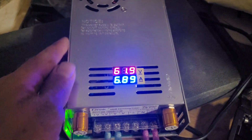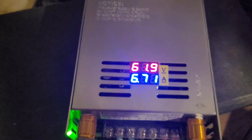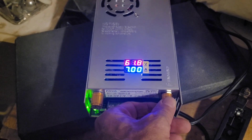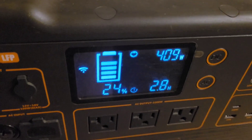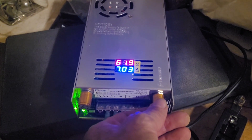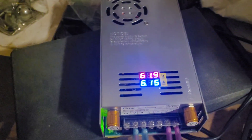I would say the Tacoma is just the limit — looks like 270 to 280, sorry, 278 to 283 watts is the limit on what I can deliver to the bed of the Tacoma. I'll turn this up a little bit more to 7 and see what I can get — 410 something like that. Alright, that's pretty good. I'll turn it down now so I don't risk burning out the fuse.